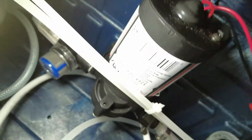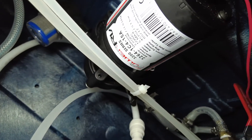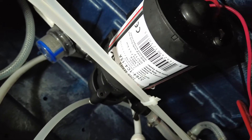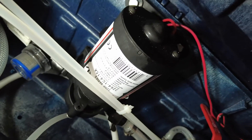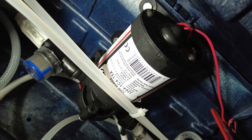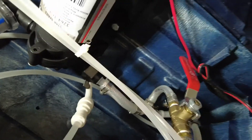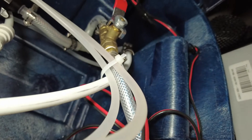The water is being sucked up through my Remco pump — it's the series 3200, mounted upside down so that the motor, if it does leak, doesn't get wet and cause a major failure. I've got two ways to get water: drinking water through the clear hose, and through the braided vinyl hose water goes to our kitchen faucet inside the van.